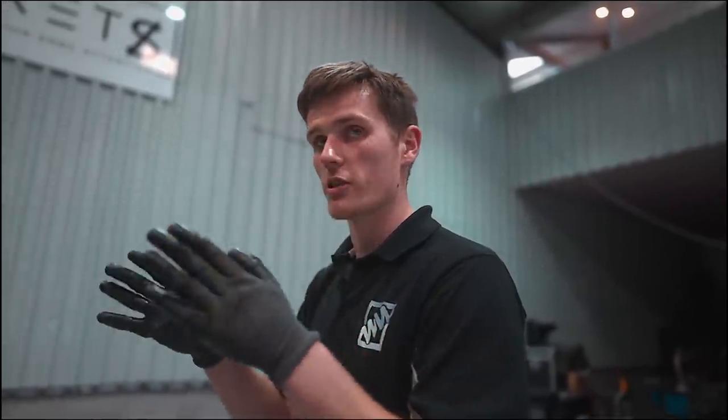And what do you do at the front? First of all, centralizing the steering wheel, making sure that's perfectly in the middle, then take the measurements, and again we're going to toe that in but not as much as the back, so you get sharper turning but you still get high speed stability.